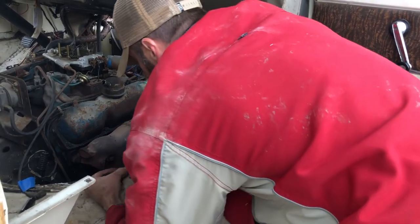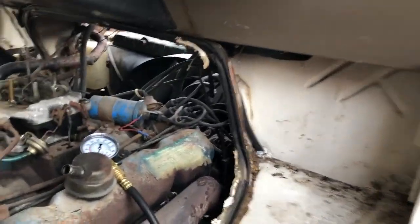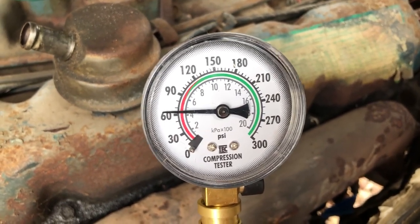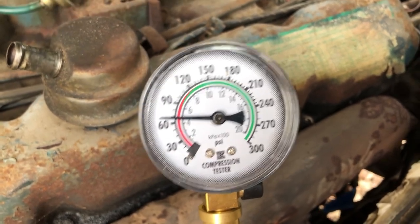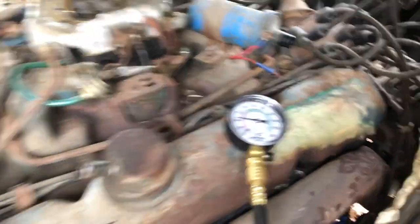There's your tester. So this is cylinder number four - throttle's wide open cranking - 70, 70, 70. Yeah. I didn't know what those little lines meant, I had to count it out. So yeah, 70 on that one. I don't know exactly where to go with my two low cylinders. Maybe it needs a valve job. The lifters were getting a little noisy on the drive home a few days ago - maybe the lifters would affect that, I'm not even sure. So I am trying to consider my options here, but I do believe I need to do something to improve the health of this engine.